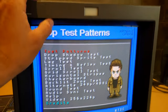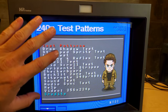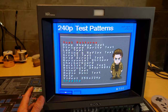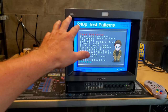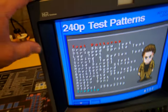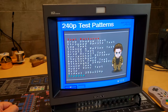Here's why this repair is so important: this is a problem that can happen on really any CRT — I've seen it happen to consumer sets, other PVMs, and PC CRTs as well. The problem nine times out of ten is related to those deflection capacitors. So if you go into your CRT, no matter the model, and change those deflection capacitors, that generally cleans up the image and fixes everything. Now this thing can go back to its owner. Thanks for watching everybody — leave any feedback in the comments below and I'll see you next time with more retro content.